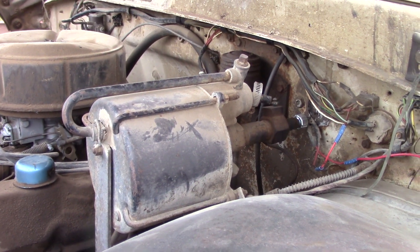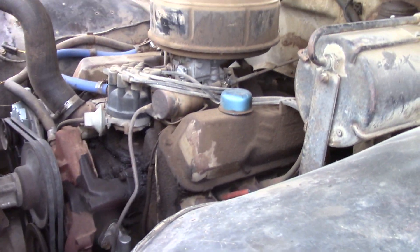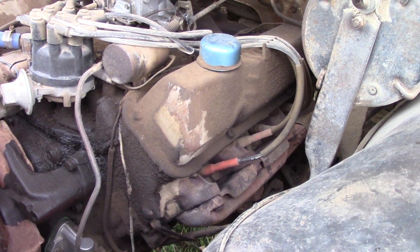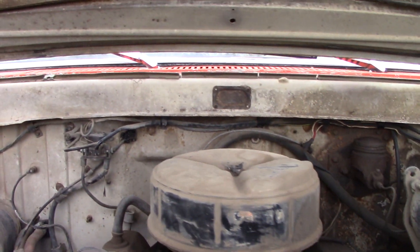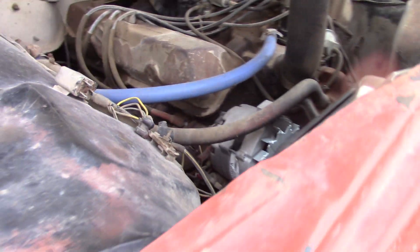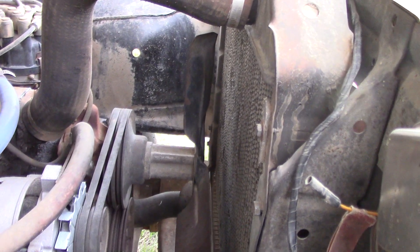You have to take up a little bit of slack out of the brake pedal before it starts to kick in, but the brakes work fine otherwise. I do need to go through and put new plugs and wires on there — just a general electrical tune-up. It's got a miss; I think it's electrical but haven't really dug into it yet. The horn isn't working either. When I got it the relay was unhooked. It didn't charge either — first tried an alternator, that didn't work, then replacing the voltage regulator fixed it. The idiot light in the dash works now.